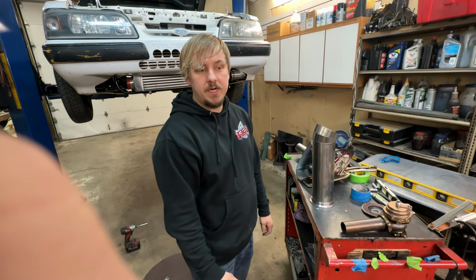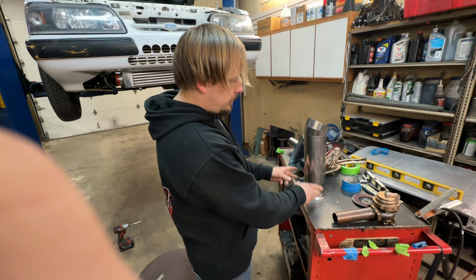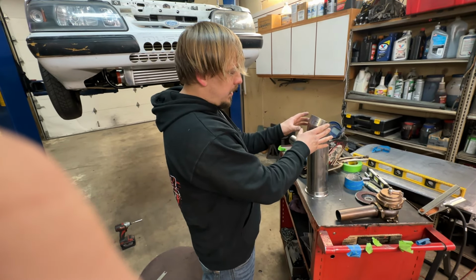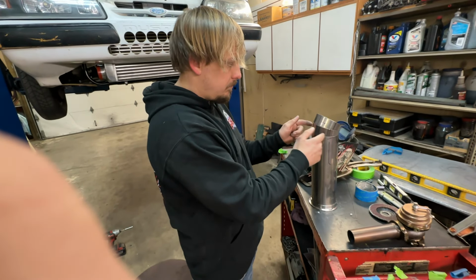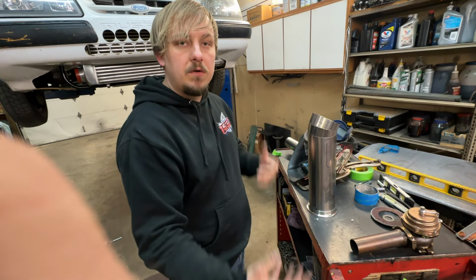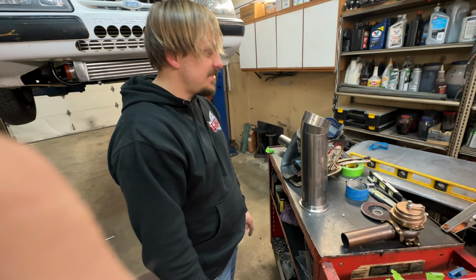Okay, now that the welder shut off, I'm quiet for a second. So I got my little extension piece here. We've angle cut this here. We've made two pie cuts. And I've already tacked these two together, made our marks. We're gonna tack these two pieces to here, and then we'll test fit it again and get kind of like a final product of essentially the tip. So, just the tip.